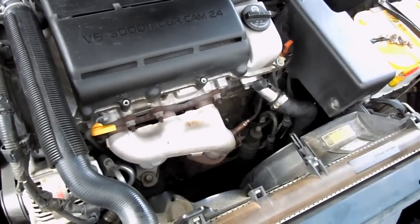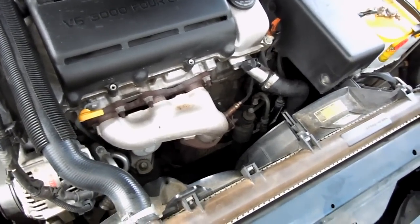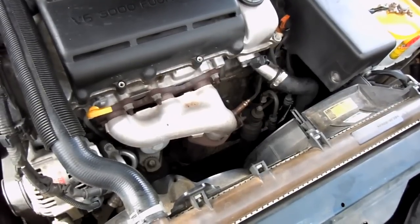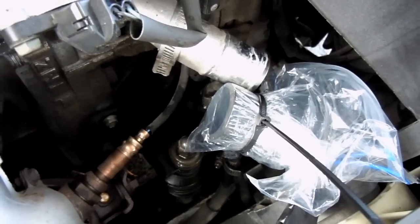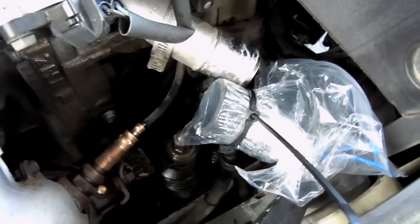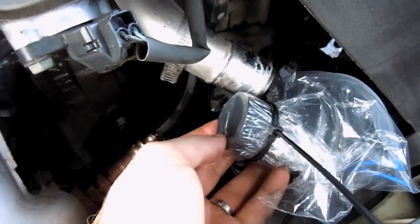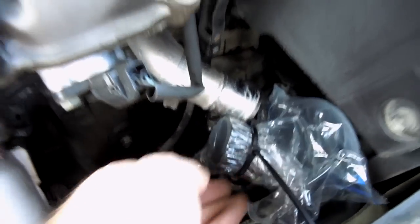What I want to do is isolate this radiator and put the fluid just in the radiator, because I don't want all that junk circulating through the engine once all the debris loosens up. After I fully drain the radiator I'm going to take two plastic bags and a zip tie and put it over that hose so the vinegar doesn't come out the bottom.